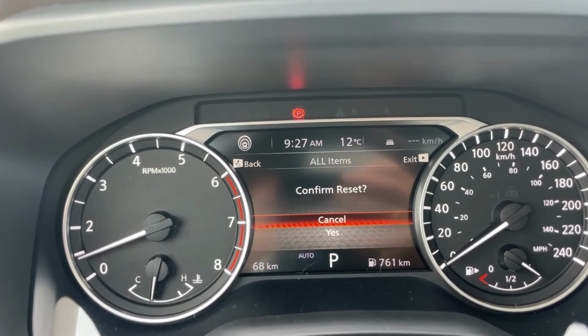Now, the next step in that would be the automatic emergency braking. So if the car in front of you slammed on the brakes, again, because it realizes you're closing that gap in a hurry between you and the vehicle ahead of you, it'll beep at you, it'll flash the warning here, and if your foot does not get on the brake fast enough, it will start to hit the brakes for you to avoid or minimize an oncoming collision. And as soon as your foot is on that brake, that system turns off because you are in total control of your vehicle.